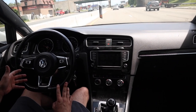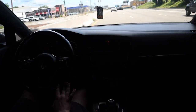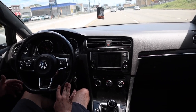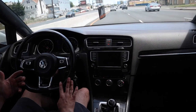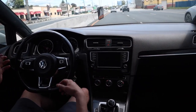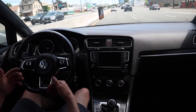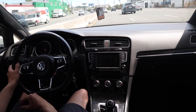Eventually I'm going to have to do the clutch on this car because I do plan on tuning the car and doing some mods. I know that the stock clutch will not be able to handle the power this car is going to have. This car will probably be a low-300 wheel horsepower car and maybe high-300 to low-400 wheel torque car, so it's not going to be anything too crazy, but the stock clutch cannot handle that kind of power.